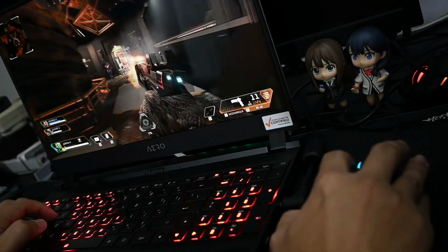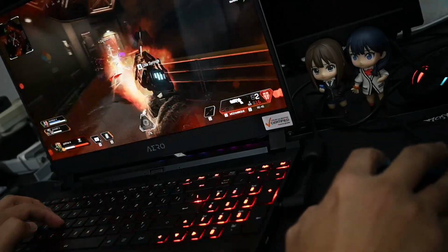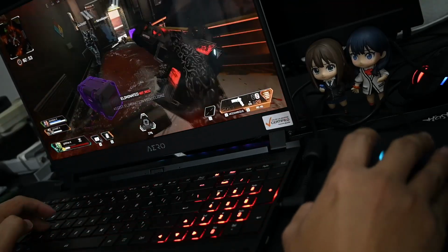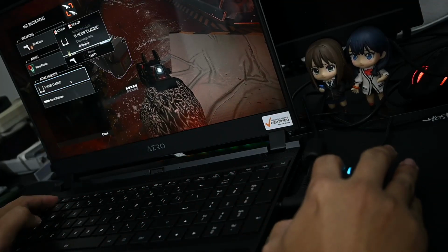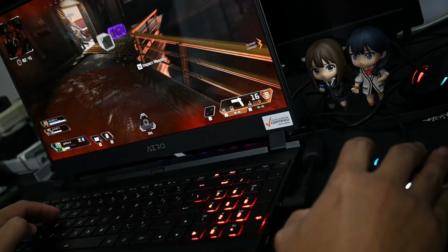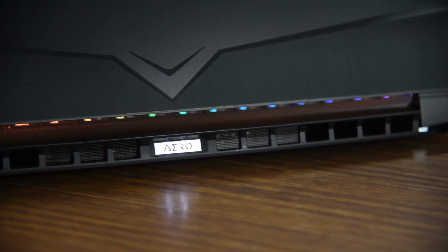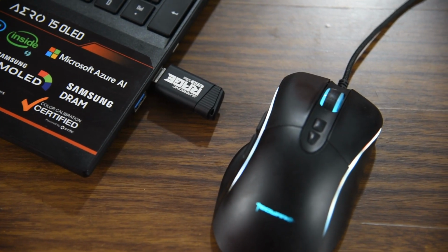While the Gigabyte AERO 15 OLED XA has gaming PC specs, I feel that it's more suited for content creation purpose. As for gaming, no doubt it will still perform, but I recommend running games at Full HD rather than 4K because the RTX 2070 Max-Q wouldn't be strong enough to handle 4K resolution properly. There's also the 60Hz refresh rate screen, plenty sufficient for most gaming titles but just not suited for gamers that require high refresh rate. I like that the AERO 15 exhausts heat entirely from the rear. Just don't put any chocolate right behind it and it's all good. I wish that they moved the USB connections towards the rear or the left side to free up space for the mouse.